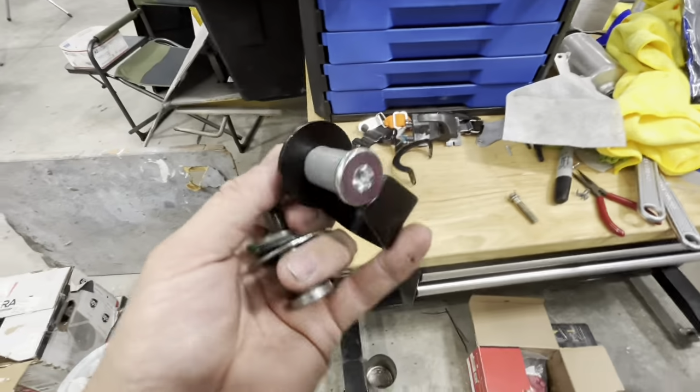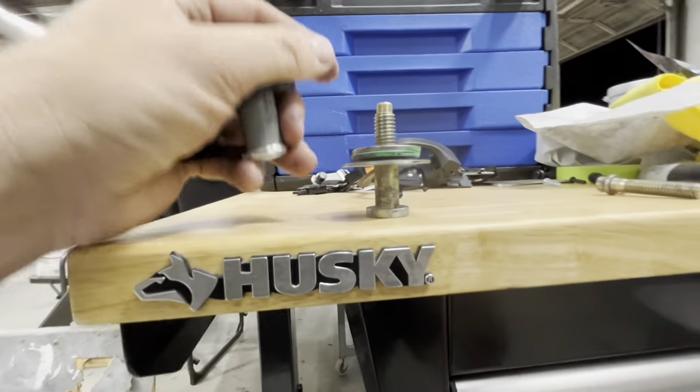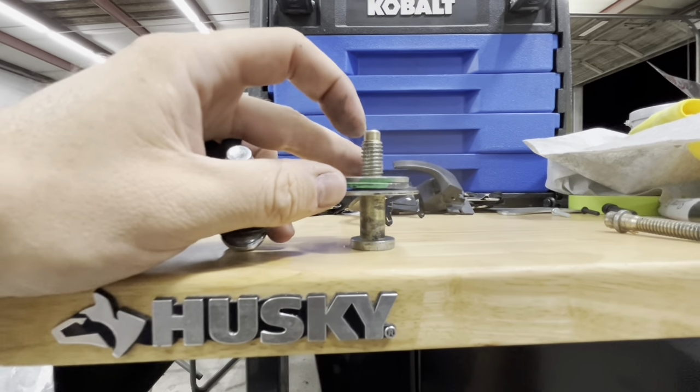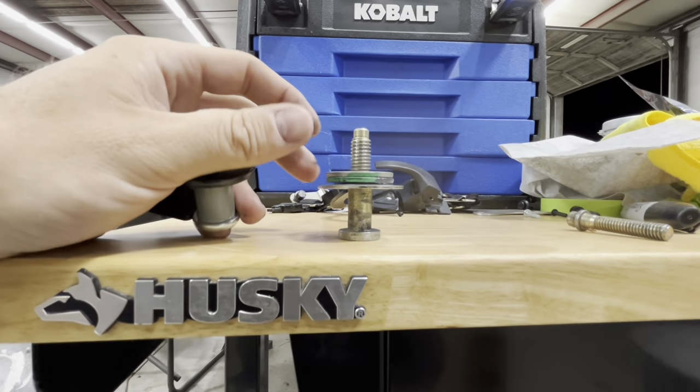All right, one thing to go ahead and check right out the gate. This is your old striker right here. So this is how the car was when I got the car the first time I repainted it, it had all these washers on it. I went through there and readjusted the washers to get the strikers where I wanted them to the door. Now, as you've seen, the door just closed fine.